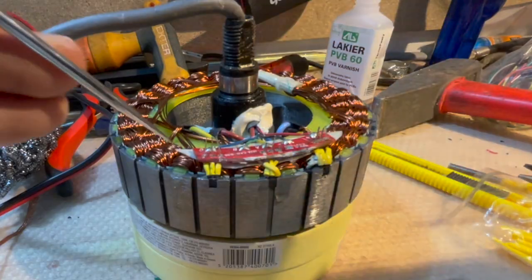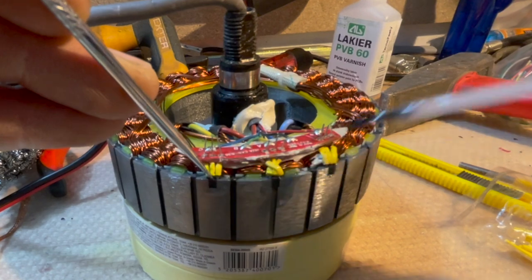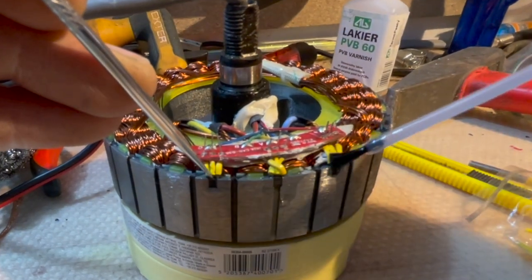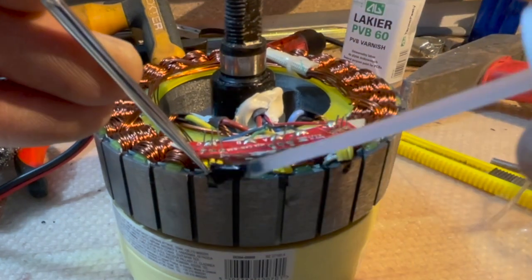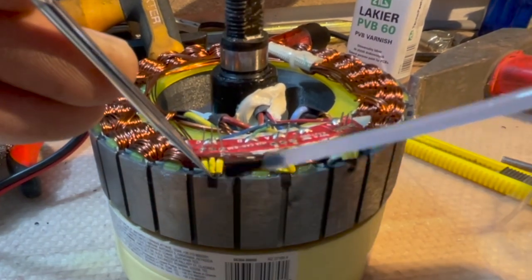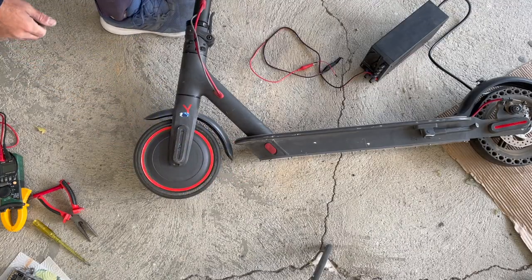After soldering the sensors, pull up all sensors with the PCB and twist the middle sensor 180 degrees so the marking is looking toward the axle. This is making the middle sensor with reverse polarity. This is needed because we use the same polarity sensors, as it is hard to obtain the middle sensor with reverse polarity.